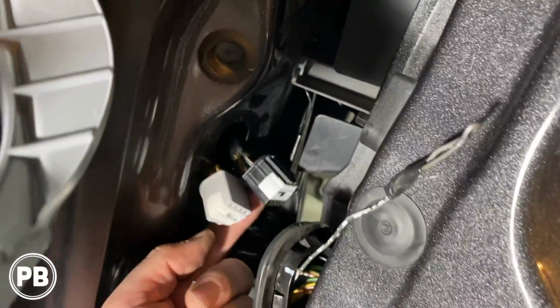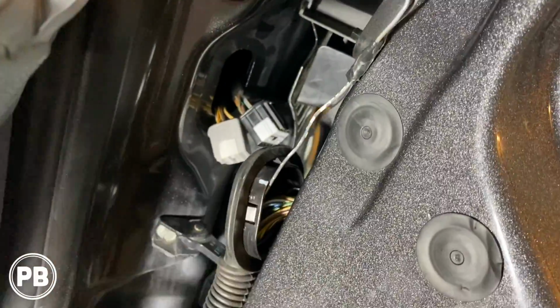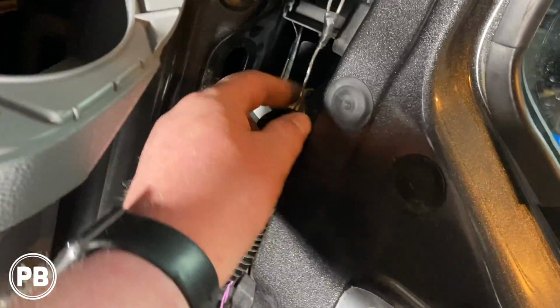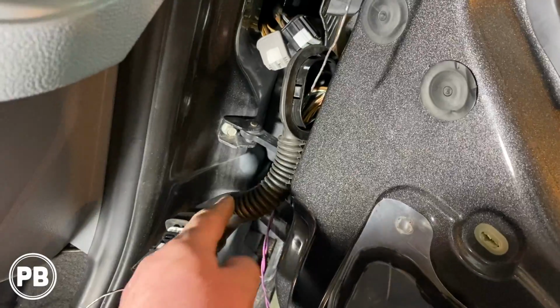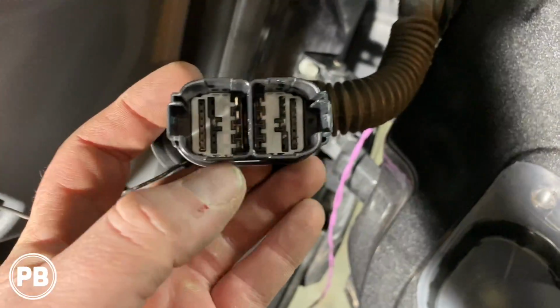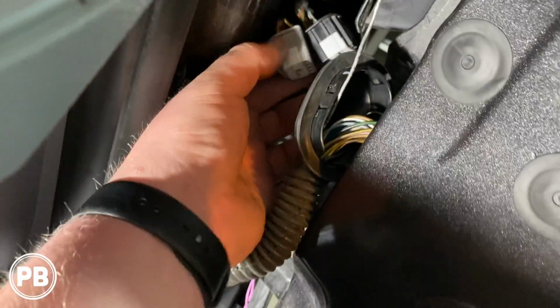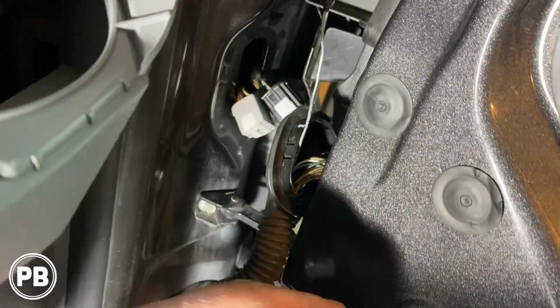Okay, so you can disconnect those harnesses. There's little tabs, and it disconnects out of the boot here. And then I got a hanger here and fished up through that so I can begin pulling our speaker wire through the rubber boot. Then from here, we're going to show you where to safely pass those wires through this harness, and then likewise on the male end, and that'll give us the access we need to run that inside.